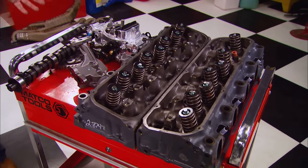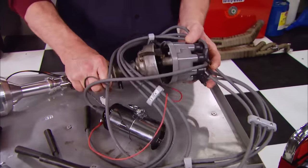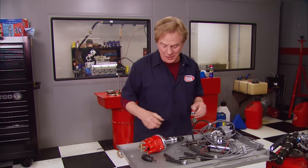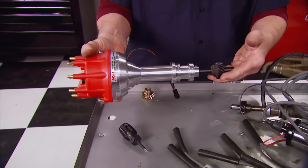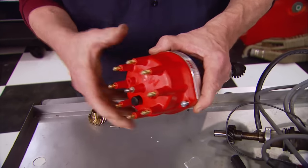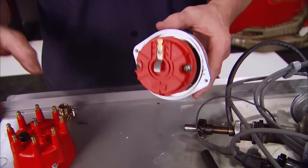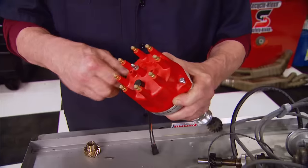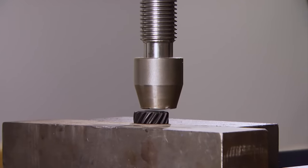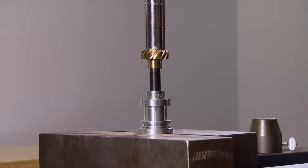These are some of the parts that came off the 460 for this next level of the project, and we'll repurpose all of these including the stock points-type distributor that we upgraded. That was great for the budget phase but not for our power plant today — we're going to need something like this MSD Pro Billet. This thing has sealed ball bearings that guide the shaft to up to 10,000 RPMs and more, with a rotor molded from race-ready DuPont Rynite material, a magnetic pickup to trigger the ignition, and a chrome moly mechanical advance assembly. Anytime you use a roller cam you should always remove the cast gear on the shaft and replace it with a softer bronze gear — it's much easier and cheaper to replace the gear than hurt the motor.